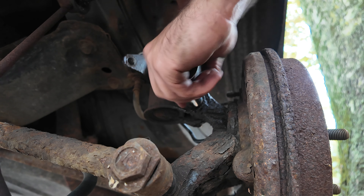Now we're just going to go piece by piece, attaching everything — not trying to tighten anything down until I've made sure I've made all the connections, and we have a majority of them done. The only thing left to do is tighten everything up: 14mm nut for the sway bar link. We have our two 17mms — I'll put a 17mm wrench on this side and use the socket to tighten these in. These I want nice and tight. And last, we want to put in that retaining clip for the brake hose in the back — get the brake hose low and then push the clip in.